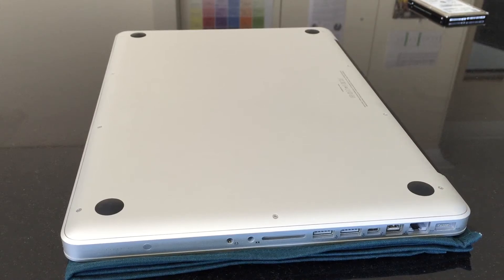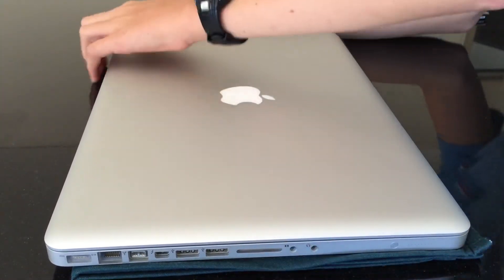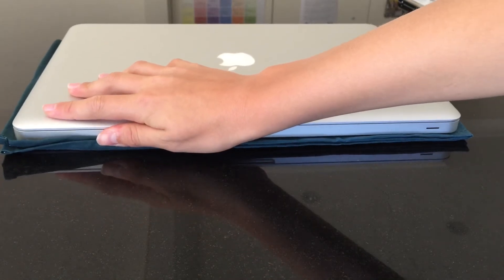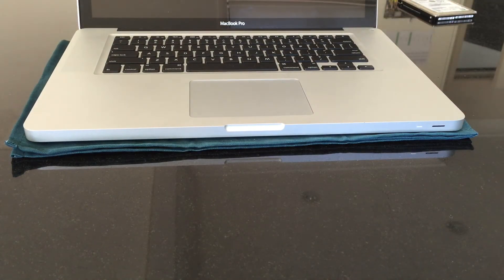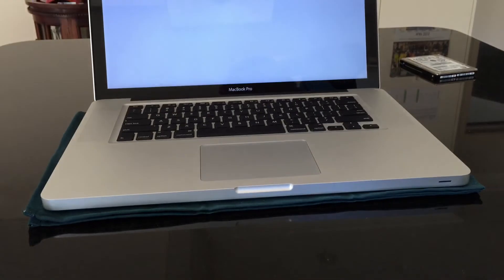Now that the cover's back on, it is the moment of truth. I'm going to flip this around so we can see what's going on. I'm going to open the lid and press the power button. The first boot will always be a bit longer, because it's going to have drive naming issues — it's trying to find the drive named Macintosh HD and it's not finding it. So it eventually searches for all drives, finds Macintosh SSD, and then boots to it. You'll see a white screen for a very long period of time on first boot. This is just something to know — it's not broken or anything.